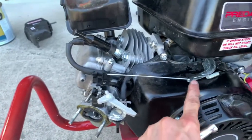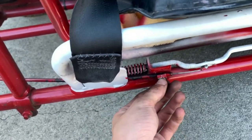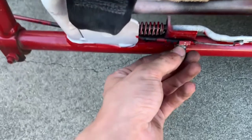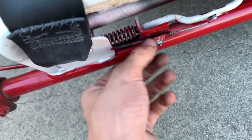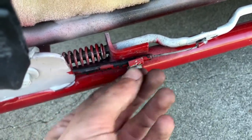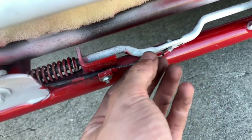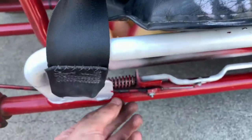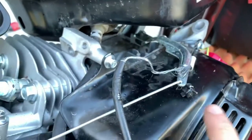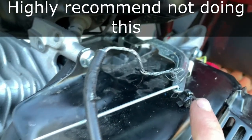The throttling is almost done. For the actual throttle cable, if you don't have any cable you're going to have to get some bicycle cable or throttling cable. You're going to want to put it in one of these clamps so it clamps here — the actual line itself will stay taut in position, but when you pull this, the inner line is the one that's actually moving when you press the throttle down.